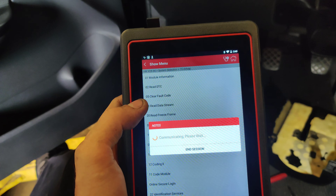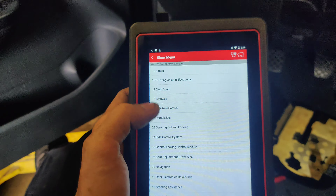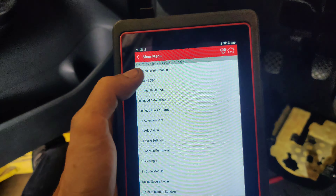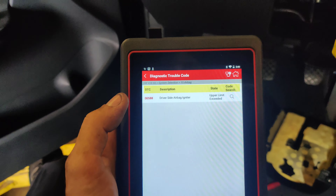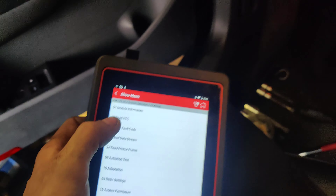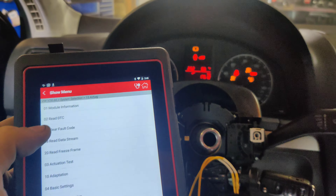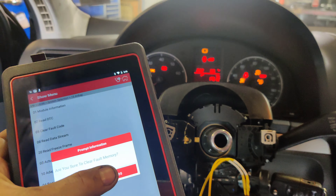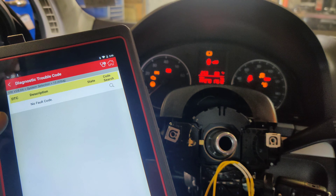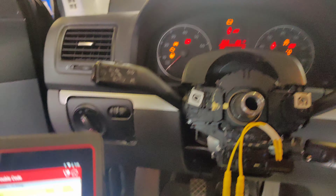But yeah, it's going to need an airbag and a clock spring so far. So guys, I just noticed looking down in here there's only four pins used, and that makes sense because we only have our horn and we have our airbag. So I'm going to connect two of them - because one's going to be a switch and it's going to turn the horn on, the other one's going to be our airbag. So I'll get my resistor back out and we'll probe it in there and we'll see which one's which.